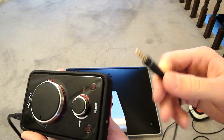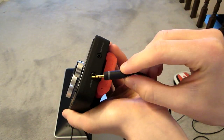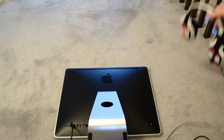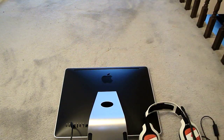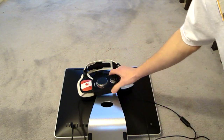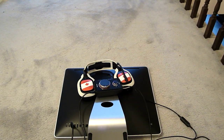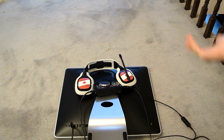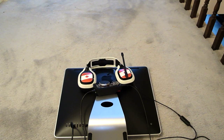Plug in the headset 3.5mm jack into the headset spot on the Mix Amp, and that's all you need. If your Mac can support an optical cable with a slot, or if you've added an audio card, that would give you surround sound. But for now, all you get with this is left and right audio since it's through USB. It's not the best — it does scratch a little sometimes — but if you turn it up you can avoid hearing that. The microphone does work perfectly and it's super clear, but you have to turn the volume down all the way on your Mac, because the microphone is so sensitive on the Astro Mix Amp when plugged into the Mac.